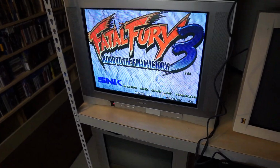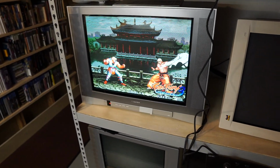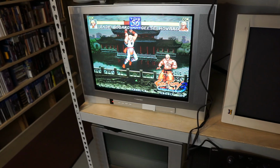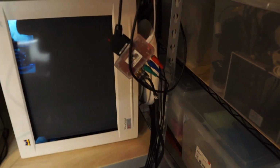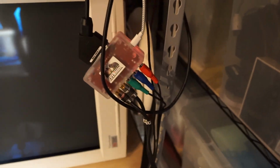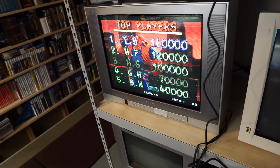This is running through Component, and I guess I didn't understand. It uses a Genesis 2 plug, like so many of these new things are using, but it won't put out composite. So you use the Genesis 2 plug to give you RGB SCART, or you can use what I'm doing here, which is a SCART cable plugged to that open source MVS or CMVS, whatever you call it, to a SCART 2 comp from RetroTink, and then Component. And it puts out like the best Component I've seen.